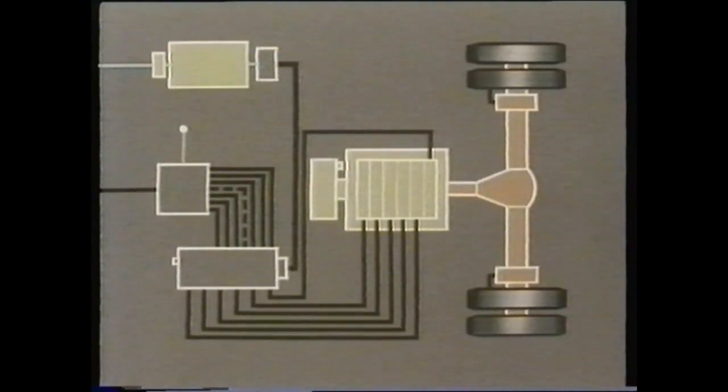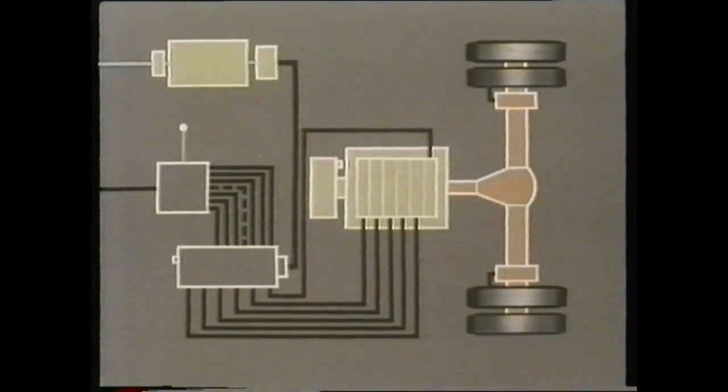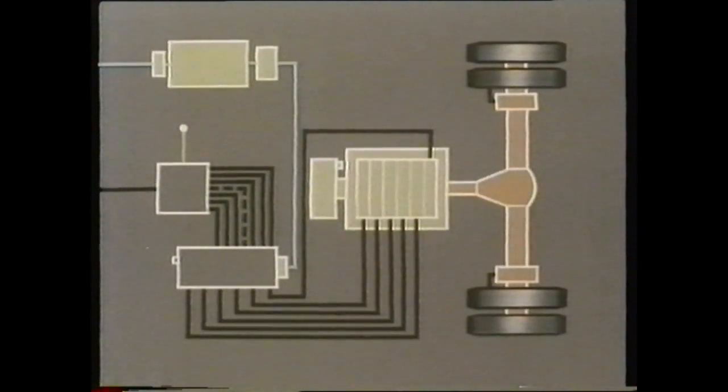There is the auxiliary air tank of the vehicle which, when charged, has an air pressure of between 105 and 120 pounds per square inch. From the auxiliary air tank, air passes to a limiting valve here. This limiting valve reduces the air pressure down to the working pressure of the control system, which is usually between 80 and 85 pounds per square inch. But there are exceptions to this pressure, so always consult the vehicle or the programmed data sheet for the correct air pressure. When the air has passed through the limiting valve, it flows to the entry point of the electro-pneumatic unit, where it passes through an air filter before entering the electro-pneumatic unit.